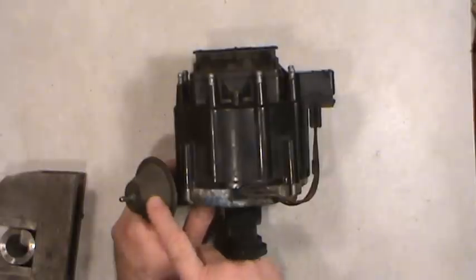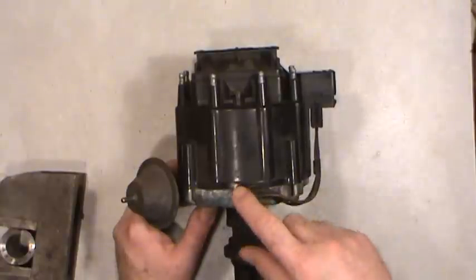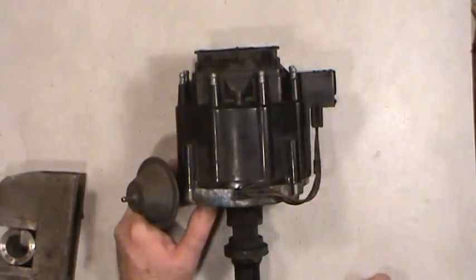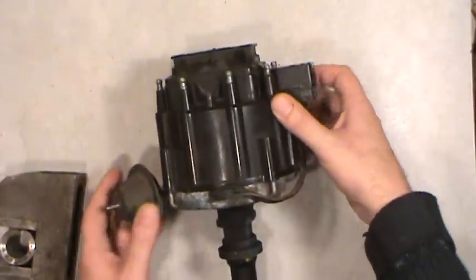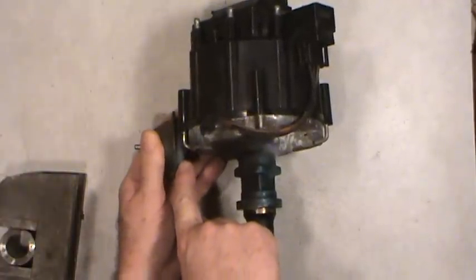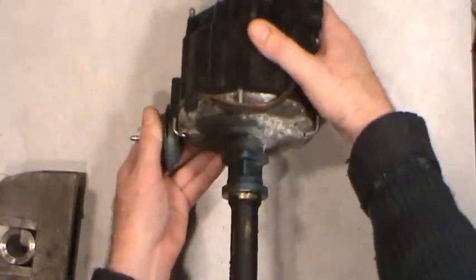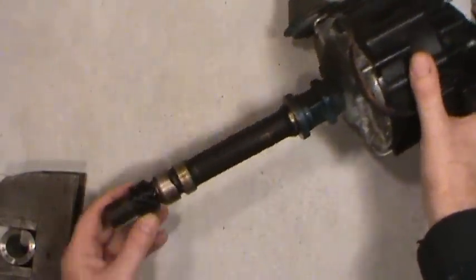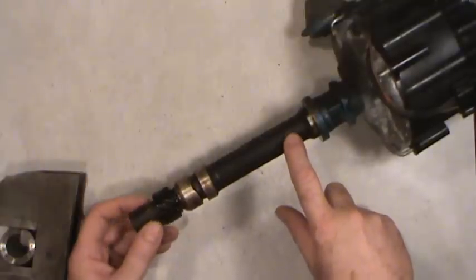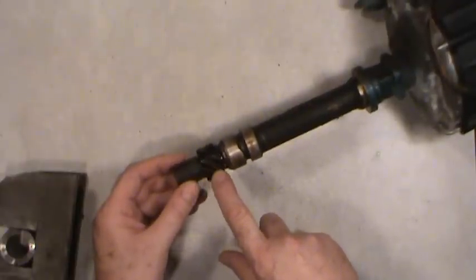Basically there's a vacuum advance here, the coil is in the cap, and there's the hookup wire from the components connected in the base of the distributor up into the cap that controls the coil firing. You can see the Chevy blue overspray on the back of the vacuum canister, and even blue paint on the bottom of the aluminum housing. With that many miles on it, you can see how much coating has built up — it's not just a smear, it's been in there for a while.